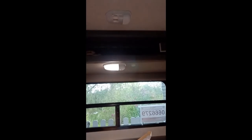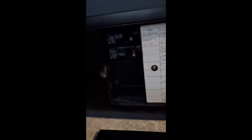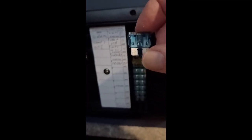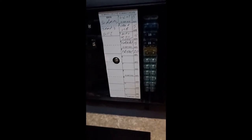I'm going to do the same for the other lamp. I also want to point out the fuse box, which is to the left and below the sink, underneath the seat table for four. There's the AC system on the left — that's a 30 and 15 amp. The 30 is the main switch and the 15 is for the GFCI outlets. On the right are the fuses for the 12-volt system. I cannibalized one of the light circuits at the top — you can see the fuse is broken with the wire separated in the middle. I'm going to buy some spare fuses and put them in unused slots so I have plenty in case another one blows.